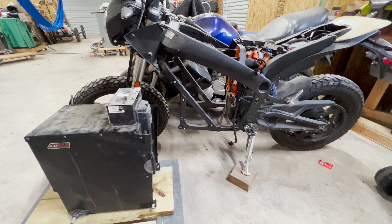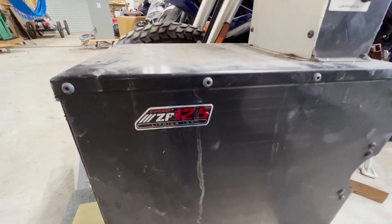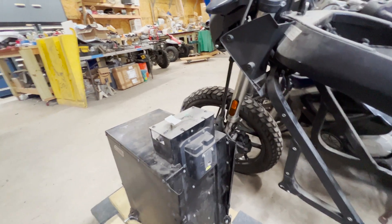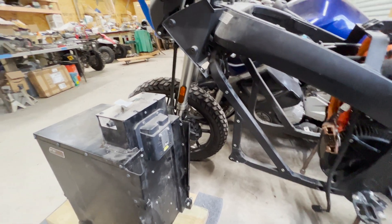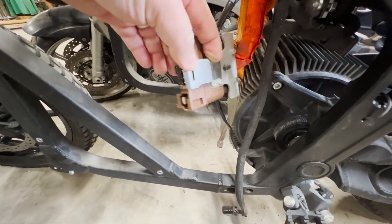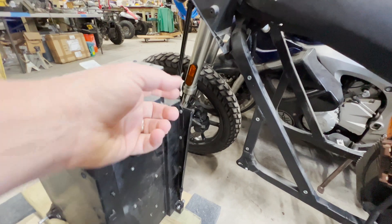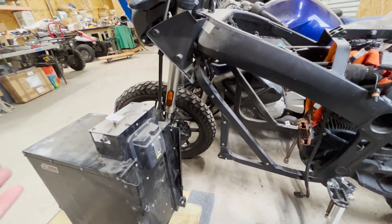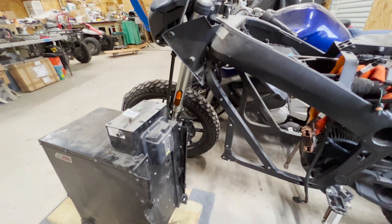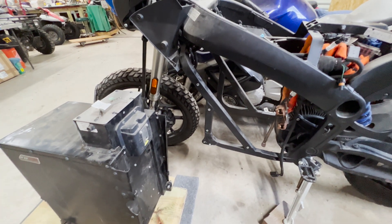Let's start with the overall overview of what it looks like when it all comes apart. This is your pretty standard ZF 12.5 battery pack. The mystery I could not find online is how this thing was held in, how it connected to the rest of the bike, and what was entailed. Turns out it's actually really simple. This right here is your main connector — the main connector that goes into it. This little clip clips on there, so you just shove it up and it clicks in. You undo that clip and pull it out. That's the only electrical component that interfaces with the battery pack. There's a grounding strap on top, and that's it.